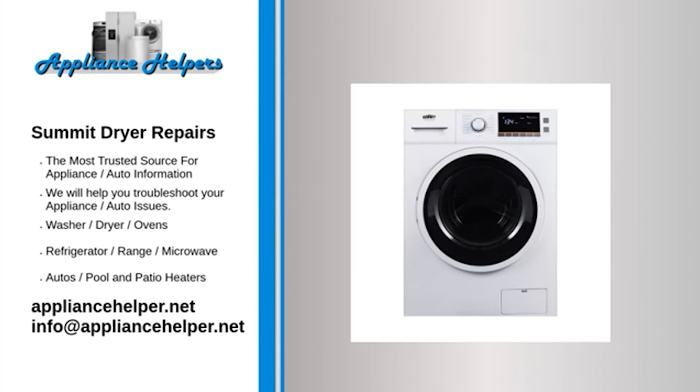If your unit is unresponsive — combo washer-dryer unit — check to see if the unit is plugged in. Often the simplest step is the most neglected one. If the unit is plugged in and still unresponsive, press the power button. If it's still not working, call a tech to service the unit. If your unit shakes excessively, double-check that you removed the shipping bolts from the back of the unit — instructions should be in your owner's manual. Also make sure the load is balanced, fabrics are separated by similarity, and the unit is on a level surface with all four feet making full contact with the floor.